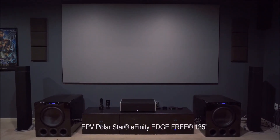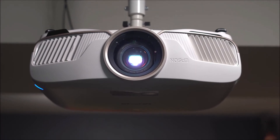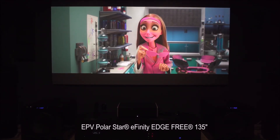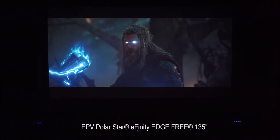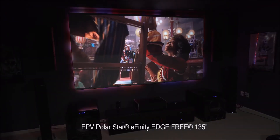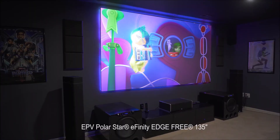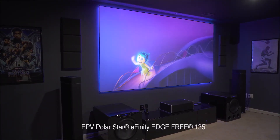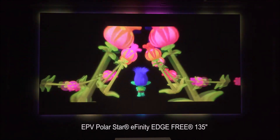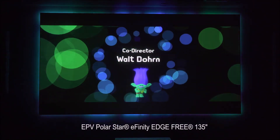The screen I'm using in my home theater right now is the EPV PolarStar Infinity screen paired with the Epson 5050UB. The PolarStar Infinity is a high-contrast ALR screen from Elite's high-end line, made for standard and long throw projectors. It rejects up to 85% of ambient light, has a gain of 1.3, and retains great black levels and color saturation even in bright rooms. You might have noticed I like putting LED strips around my screen — this screen actually comes with an LED backlighting kit. The LEDs are responding to the video on screen, which is commonly referred to as an Ambilight setup. It's a bit of a pain to set up but I'm working on a tutorial.